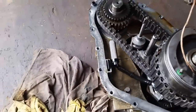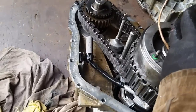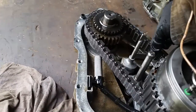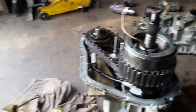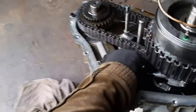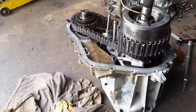That'll come off. Make sure your seal's okay. Put this off to the side, and there is our entire unit. I want to show you how loose this chain is. Even if I pull the slack out of it — still look at all this slack. It's banging around. It's actually trying to jump off these gears, I would suspect. That's why we're tearing it apart. All you have to do is unhook this oil sump pump, pull that off, then lift this whole unit off and take the chain out.